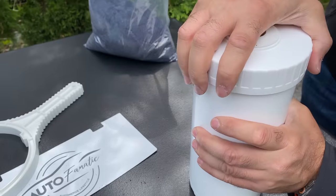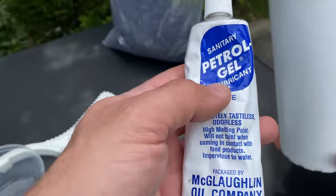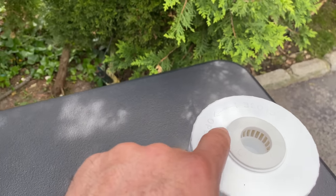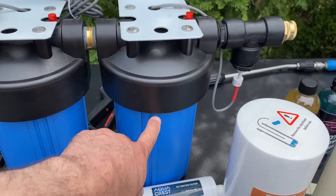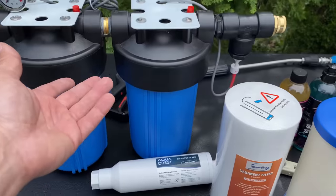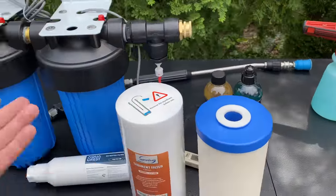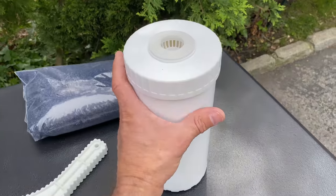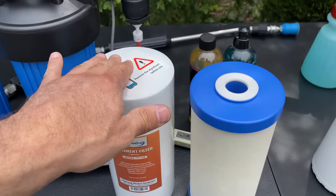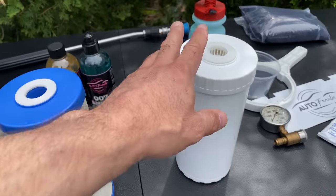Jerry finishes packing — there's a polyester pad on top, snug but not overly tight, and it keys in rather than screwing on. For the housing o-rings, I use petrogel silicone lubricant — just like lubricating an oil filter gasket on a car. If you don't lubricate the rubber o-ring, you'll never know if it's properly seated and you'll get leaks.